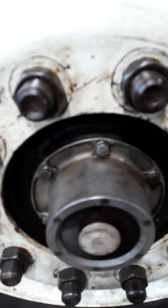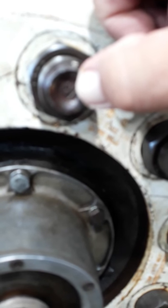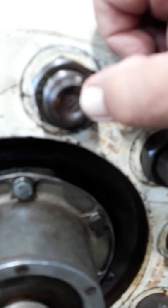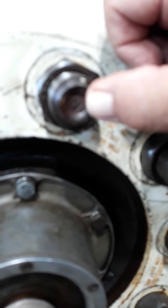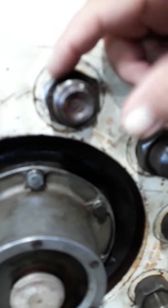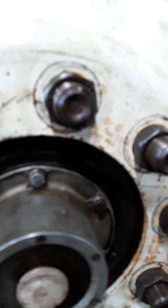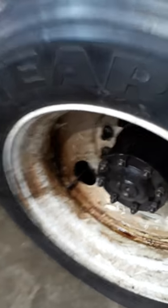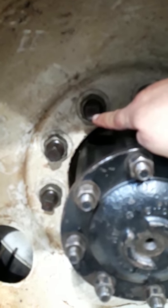Going back to the 92 Freightliner because it has a stud piloted wheel — you can easily identify it because there's no washer on the back side of the nut and no hub touching the inside of the wheel. What centers this wheel is a chamfer on the back side of the nut — sometimes called acorn shaped — which mates with a chamfer in the wheel, acting like a wedge to center the wheel through the stud itself, which is why it's called stud piloted. An important thing to remember: on the passenger side the stud end is marked R for right-handed thread, and on the driver's side it's marked L for left-handed thread, so you turn the opposite direction to loosen or tighten. Always check the end of the stud because if somebody has switched hubs, you'll snap off the stud trying to remove the wheel. The rear studs on stud piloted also have the R and L markings depending on which side of the truck they're on.